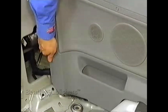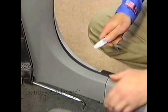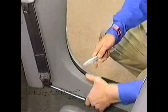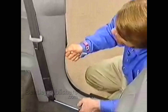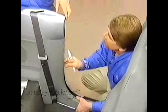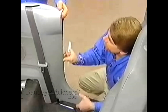Pull the rear edge of the side panel inward. To release the side panel from the sill plate, insert a plastic bone underneath, pry up and pull up at the same time to release it — hopefully the clip stays with the panel. Move the bone up and twist it to release the side panel from the body. Now we can pull it up out of the sill.